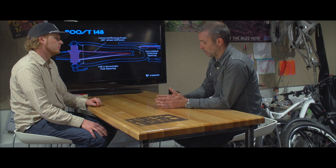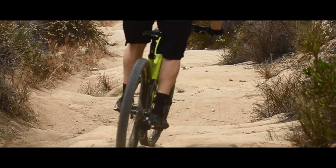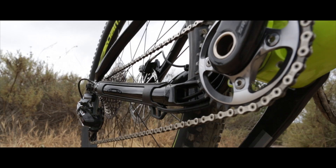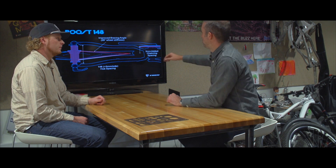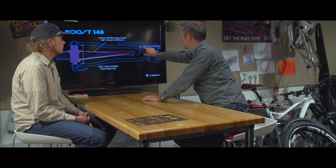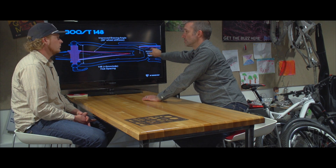By widening the hub, you can take the flanges out, which gives a bigger spoke bracing angle. For the same set of components, you end up with a wheel that has the equivalent stiffness of a 26 but in the 29-inch diameter. They're also moving the chain line out. Because the flanges come out three millimeters on each side, you have to affect the chain line as well — otherwise you'd get a big chain line offset and worse shifting. It also creates more room in that tight area from the bottom bracket, where you're always trying to maximize tire clearance, minimize chainstay length, fit big rings, especially as you go to single rings.